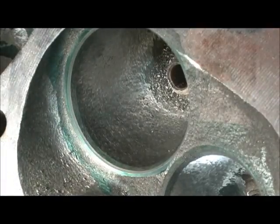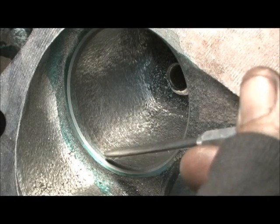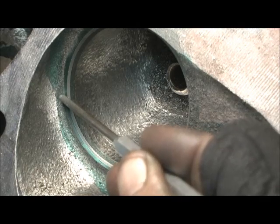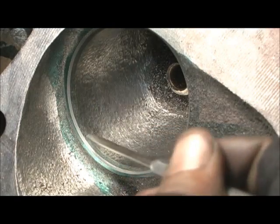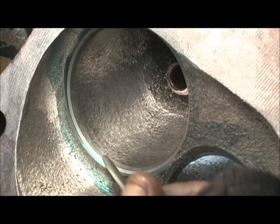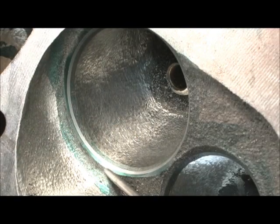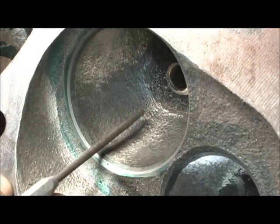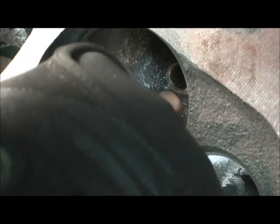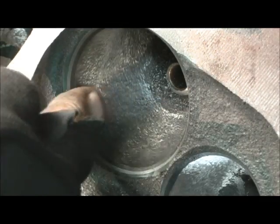Let me move the light around so you can see. Basically you see the gray, then you see the green — that little patch of green right in here. See the gray? The green on this side, the green on this side, then the green underneath it. See the green on this side — that's the 30. There's the 45, there's the green right there — the 60. Now look at the port work, how that is all cut up and pulls in. You have to see green, gray, green, and then the shiny of the bowl — a blend where when you run your finger right there across it, you don't feel a lip or any kind of big radius. It's going to run right from the edge of the 70-degree angle — you run your finger back and there will be no humps or intrusions in the way.